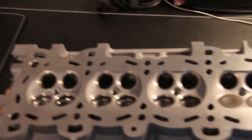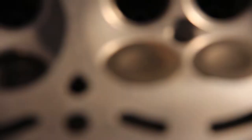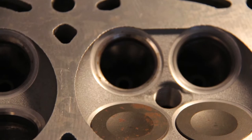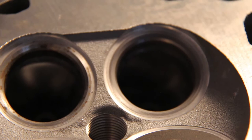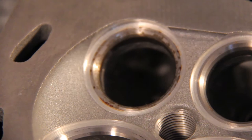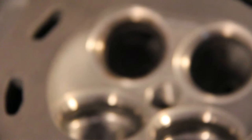The reason I'm doing this - it's a brand new cylinder head with new valves but they've been sitting on the shelf of some shop for a long time. You can see on this valve in particular there's corrosion on the top of it, which obviously is not ideal. The valve seats do have some corrosion in them too. Most of them are okay, a little bit of corrosion, and there is actually one on the end which is quite bad. These are steel inserts, the valve seats, as opposed to aluminum which the rest of the head is. I want to make those seats where they meet the valves as smooth as possible, and with the corrosion there will be some pitting.